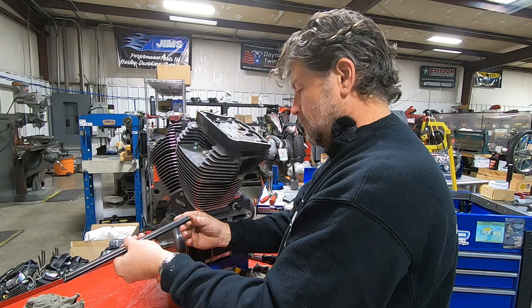Now for the inner tensioner — see that one there, it was time to replace this one too. It's about a little less than halfway through, but certainly time to replace it. So in this case I would replace both. This is normally flush, but you can see the amount of wear on this side. Yeah, close to half on that one as well. The inner one is worn a little bit more than I would typically see at 15,000 miles.